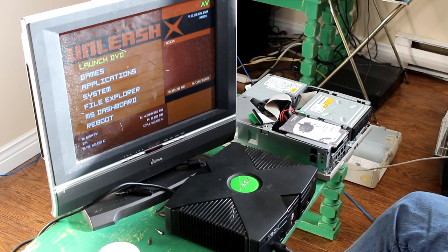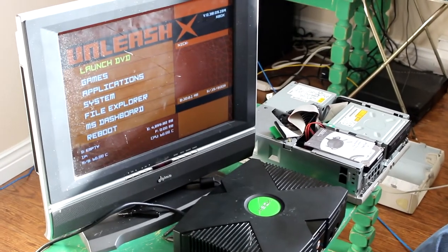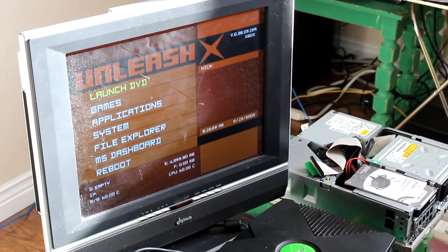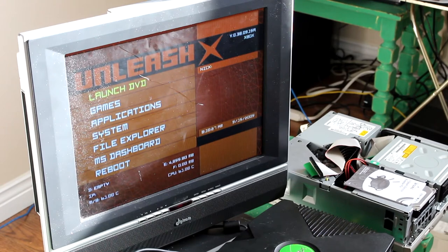The reason he suddenly said that is because I was about to open the drive and put it in right away. With a soft mod, it generally doesn't read the discs properly unless you boot to your actual soft mod first. So wait till the menu you see there now is on the screen.